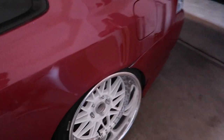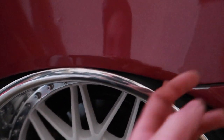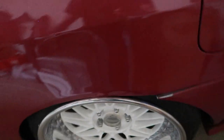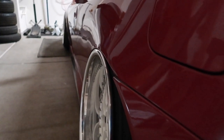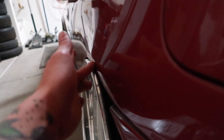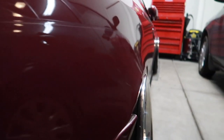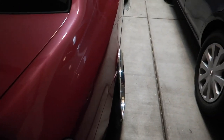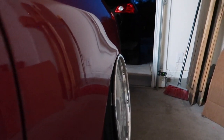So I think this is just as good as I can get it. The tire is literally on the inside of the rear quarter panel here — this is almost how my 11s fit. My wheel isn't really showing too much barrel with the stretch because Nestor and I just aired the hell out of these. I wish I could go back in time six years ago with the knowledge I have now about cars and just shaved my rear quarter panels — this is pulled out like three or four millimeters back when I was running my 16 by 9s. But at least it's not entirely on the wheel now, so I think we're good. The next thing I'd have to do is run a 205-40 that's not a Federal, so it doesn't run wide. But these tires are still brand new with less than 100 miles, so this is just going to have to do.